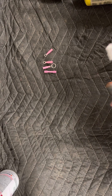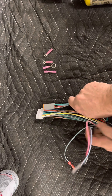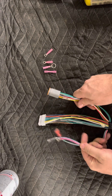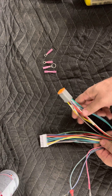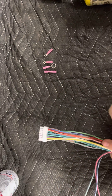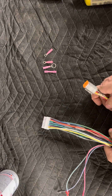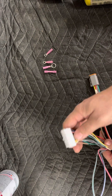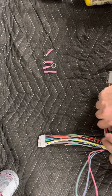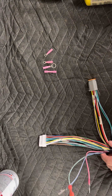Today what we're going to do is take a factory wire harness for a Club Car DS IQ and bypass the OBC circuit in the wire harness to allow the car to run and operate without the OBC. After we do this and ship the harness out, there will be no sign of this plug ever being there — you just plug it directly into your controller and everything will work like it's supposed to. If you have to do it yourself, this is how you do it.